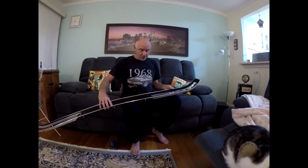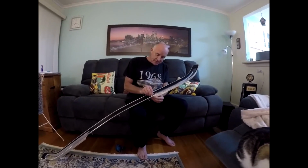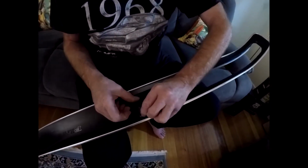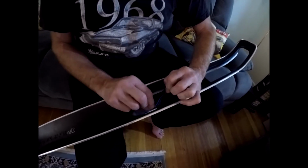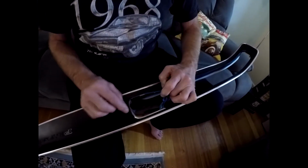It's quite fiddly, so I've virtually untaped it, but this is basically the last piece of untaping. So if you can see, you put a line of fine line tape down first, and that gives you the sharp edge, and then you use the regular masking tape to isolate it. So you can see by pulling that off, you get your reel end to drag it back on itself, so that it cuts nicely. And that's what happens when you don't.